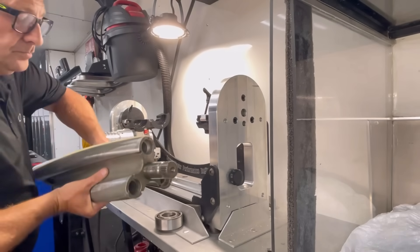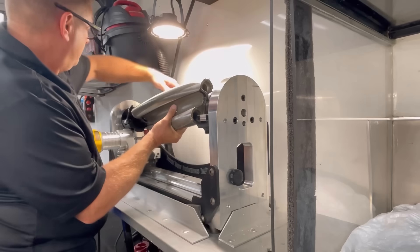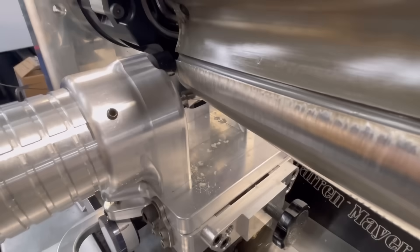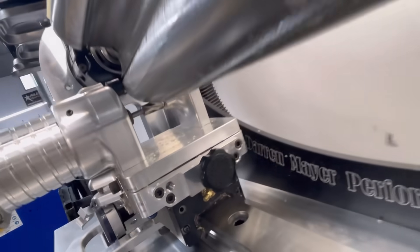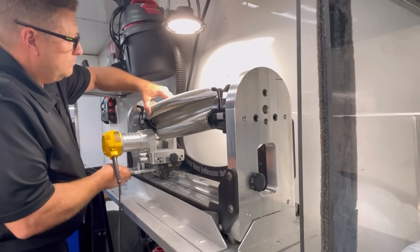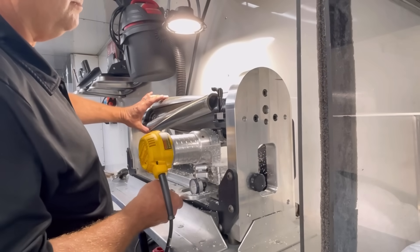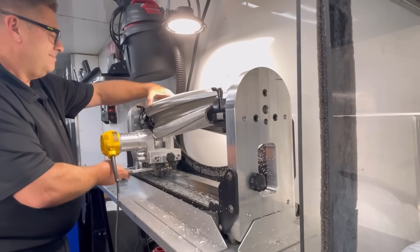Now what I'm going to do is load the rotor in the machine. We use the same size bearings as what we do in our front and rear end frames. I always keep the one marked F on the front and R in the back, just in case there's a difference between the bearings, so when you're cutting it's apples to apples every time. What we're going to do with this machine is cut the plastic down to a size that fits inside that case and gives us some clearance. You can see where that rubber snubber is up against the edge of the rotor, and as you move it down through here you'll see this thing twist. I'll roll this thing down through there and make this first initial cut. You don't want to be too fast with the first cut because you are taking off the most amount of material. The next cuts — within a thou or half-thou — you can go a little faster. Once I get this strip cut, I'll take my measuring tool and measure how high the plastic is on top of the rotor.